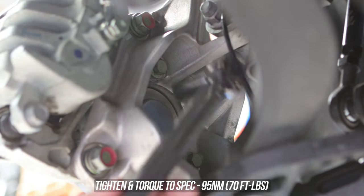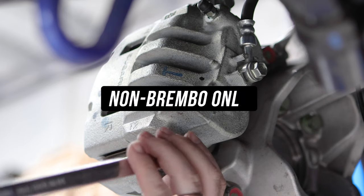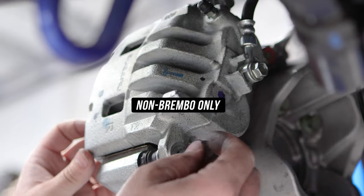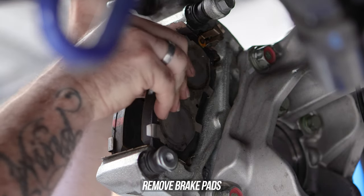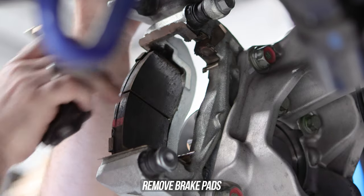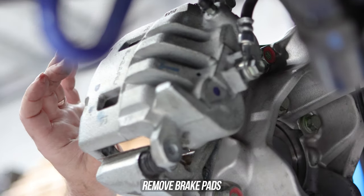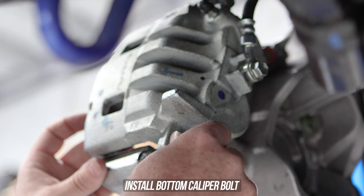Get your shiny new hub and throw that on, tightening and torquing the bolts to the specs shown on screen in a crisscross pattern to distribute the load evenly. Your car has officially begun its transitional period. This next step only applies to non-Brembo setups — if you're blessed with Brembos, this step is not required. Remove your brake pads from the vehicle by removing the bottom bolt on the caliper slide, flipping the caliper up, and snatching those pads out. Put the bottom bolt back in so you don't lose it.